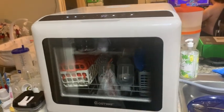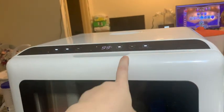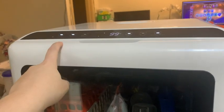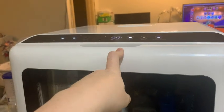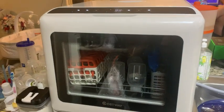And that's how you do it. If you ever get the error E1, that means you don't have enough water. Go ahead and turn off your dishwasher, turn it on again, select the program, and then fill the water until it beeps — and it should be good to go.